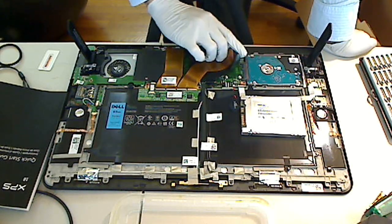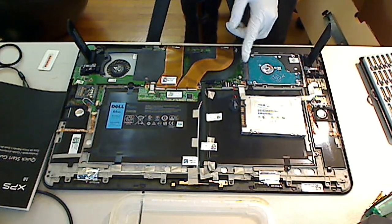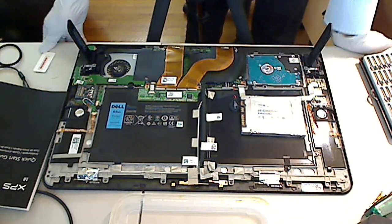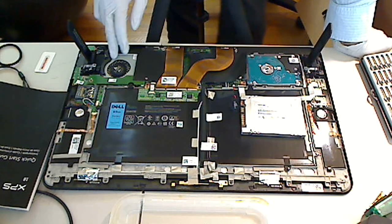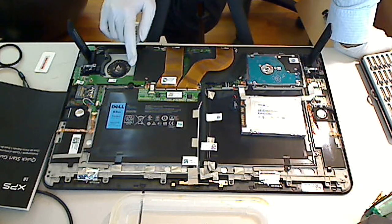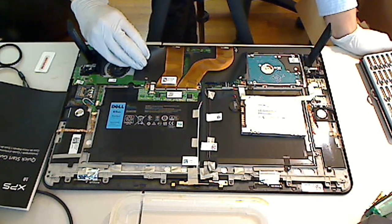So from the looks of it, I'm removing this tape and this piece of plastic. You want to be careful because you can't damage this ribbon — especially these FPC connectors. Once you damage those, they'll pretty much break whatever the digitizer uses. Also it's interesting that there's a fan in this unit, and this fan goes right on top of the CPU.